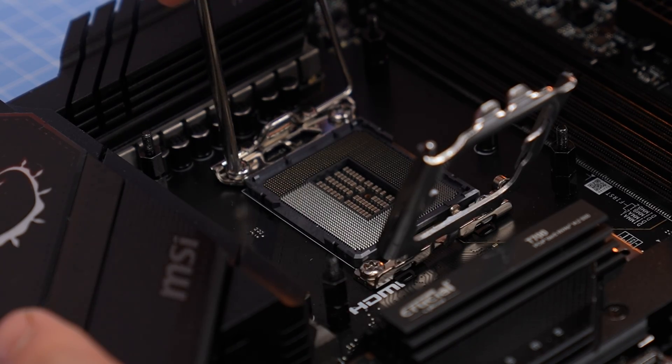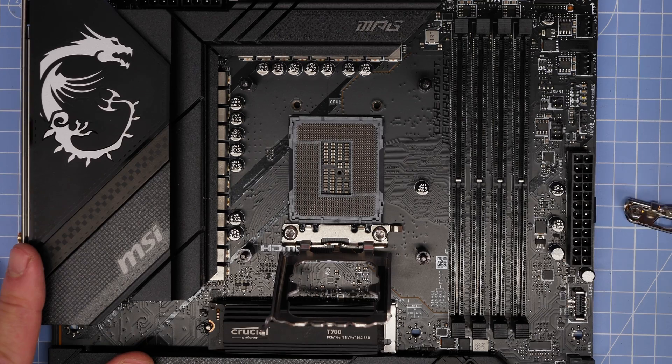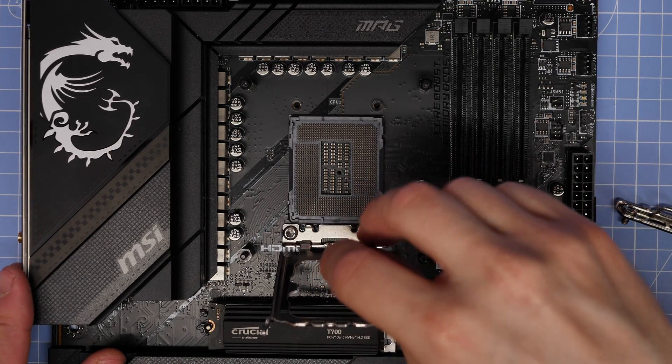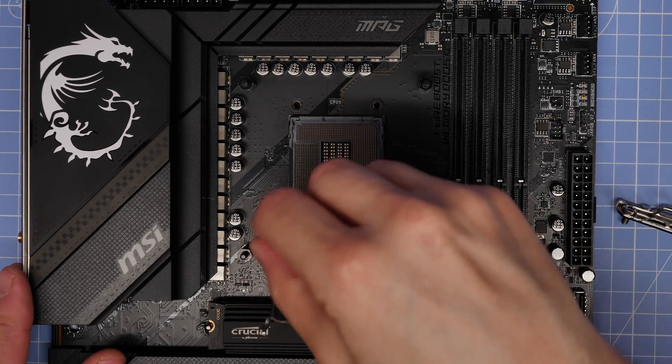What you need to do is follow the instructions to remove the screws from around the standard bracket on the CPU. You can see we've taken the CPU out, opened the levers up, and then you unscrew the four screws at the top and bottom of the CPU and carefully remove the brackets. You need to take real care not to drop anything into there, including the screws, because if you drop them into the pins on the motherboard you could potentially damage that, which could ruin your system. So be very careful during this process.